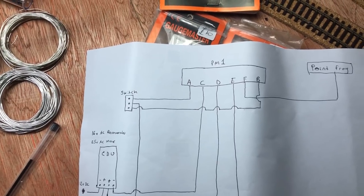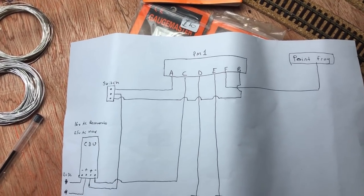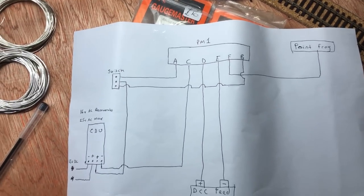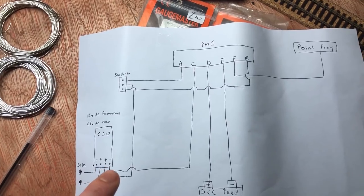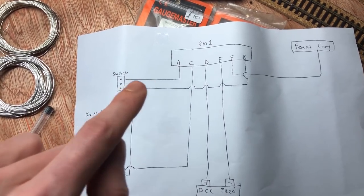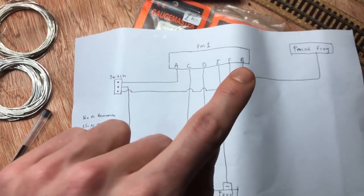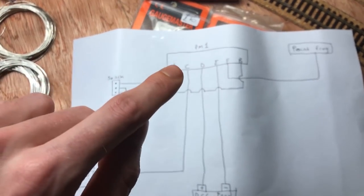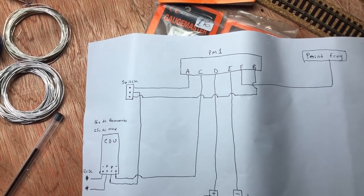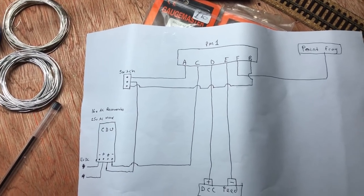You don't need D, E, and F. That is literally simply it if you want to do it the simple way: power into the centre of the switch, then one wire to A, one to B, and whichever way you throw it, power will go into those terminals and out through C into your negative. It's quite simple circuitry and a lot of people can do this quite easily.